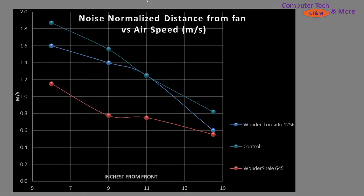Now all that information doesn't mean much without being able to compare it to something, so my first step is comparing it against my standardized control fan. It is based three parts A12X25 to one part A14 — two fans that are good in their respective categories in my testing overall. Above that line would be good, better, best, great fans; below the line would be almost good, okay, bad, or terrible fans. The Wonder Snail noise-normalized is a little bit of a poor performer, except at the 14.5 inch mark where it seems to do relatively okay. The Wonder Tornado sits fairly close to the control fan, a little bit underperforming it overall in most data points, but what I would call sufficient.